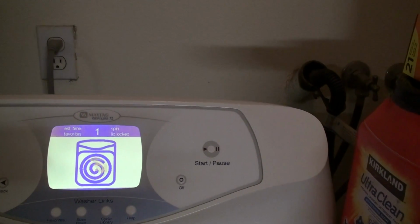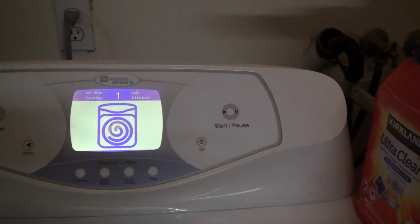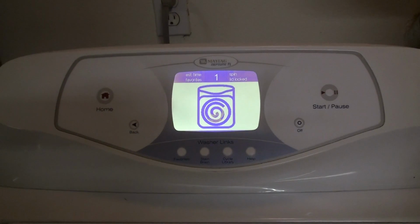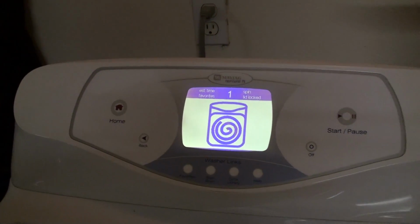So probably as preventative maintenance, maybe do it every 4 or 5 years, and maybe you won't even get those errors. Or just the moment you start to get the load unbalance errors, go ahead and take it apart, re-grease that bearing, and you'll be much better off.